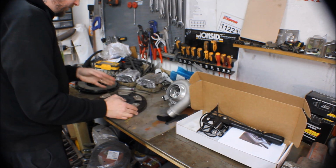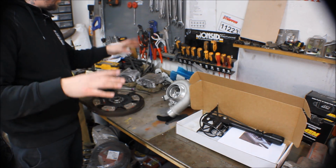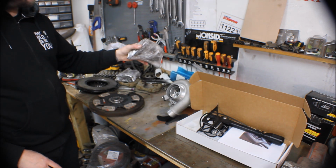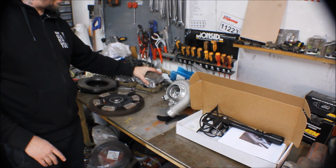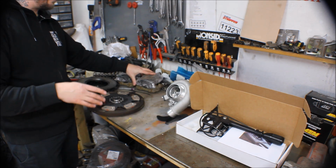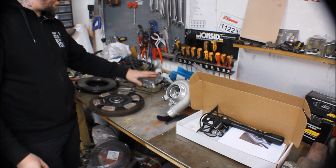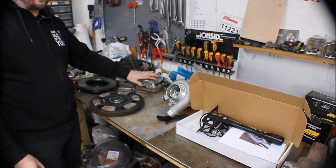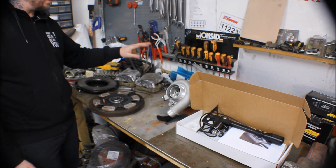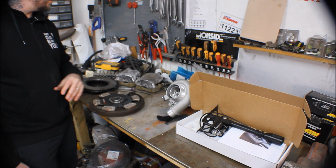So that is coming up very soon. While everything is gone and out, I went ahead and got a set of new brakes for the rear. So this is a 2000 Aero, so I don't know the millimeters on the stock brakes in the rear, but this is the 02 to 2010 upgrade, so this will run the 300 millimeter ventilated discs.